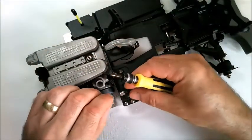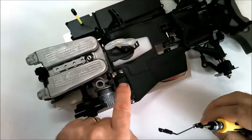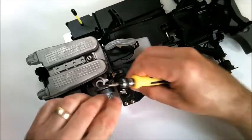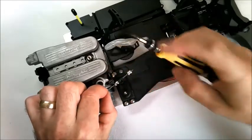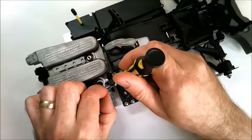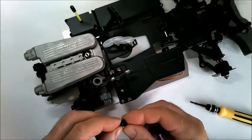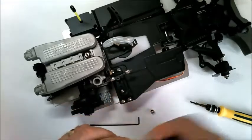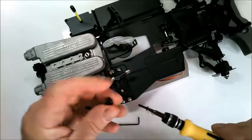Next, using a 10mm screw, you can fit the throttle arm assembly into the end hole on the servo arm. Just put the guide over the hole, then put the screw in and tighten it up. You can then fit the second guide into the inner hole of the servo arm with another 10mm screw.